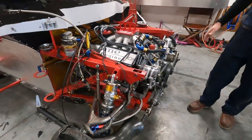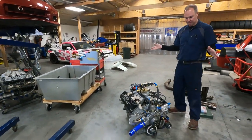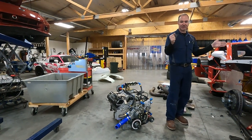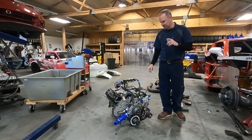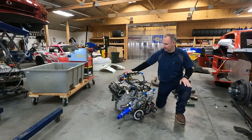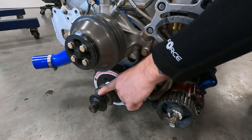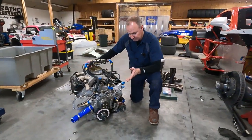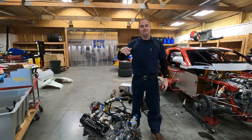Why are we changing this engine? Here's our tip of the day. Here's the old engine. So everything was cool, went down to the track, and apparently the display for what gear he's in wasn't working — that really has nothing to do with this engine change, but it kind of freaked him out a little bit. I went ahead and went out on track during the test day, and at some time during the session the oil pump belt came off. These are dry sump pumps — running from the crankshaft directly to the pump. We have never had a dry sump pump belt come off one of these engines, but it did. And when that happens, you lose all oil pressure immediately — zero.